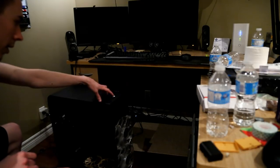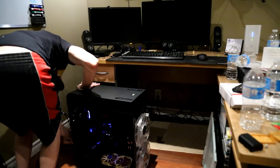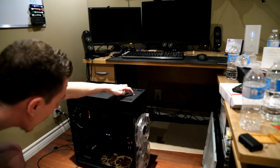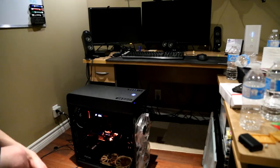There's no feeling quite like going to turn your computer on for the first time and nothing happening — it's like you promised yourself you're going to Disney World and then went to the dentist instead. I made sure everything was plugged in, double-checked the power switch, even changed the power cable to the wall — all signs pointed to it should work. My immediate fear was that my sweaty hands had ruined a component. I called my brother, and he asked about my CPU power cable. I told him there was a four-pin and another four-pin plugged into the motherboard. He told me to unplug one of the four-pins and try again — sure enough, that was exactly the issue. As soon as I corrected it, the lights came on inside and a smile came across my face.